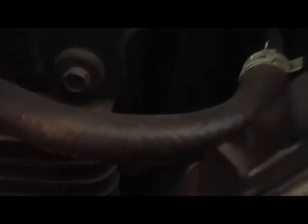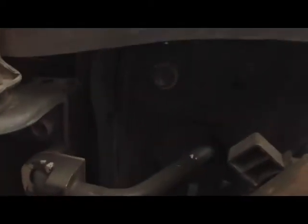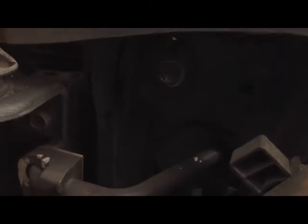The main radiator bolts are 13 millimeter and are removed from the outside of the engine well, from top and bottom. You'll have to crawl under the vehicle to get to the bottom bolt. Use your new radiator as a guide to locate the approximate location of the bolts.